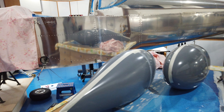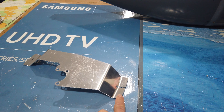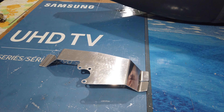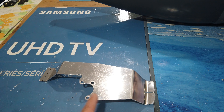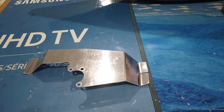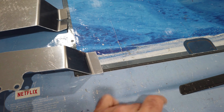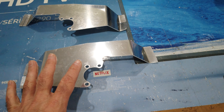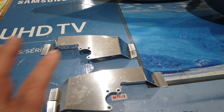To continue putting on the wheel pants I needed to remove the attach brackets, because I did not install the nut plates. When I did the brakes I thought I'd come back and do these nut plates later - well, that slipped my mind and here we are. I had to take the wheels off and take half of the brake pad off to get them out. It's only three bolts, just a little oversight on my part. Now I have to go back and put nut plates - each ear gets one nut plate and the longer ear gets two - then I'll reinstall the brackets onto the landing gear.